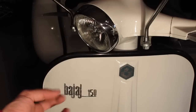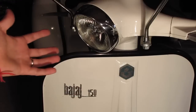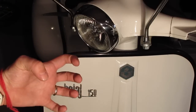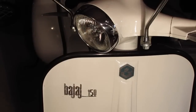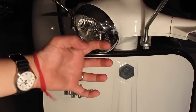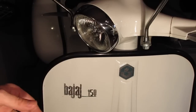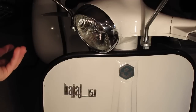Meaning it's just like a speaker membrane, and when it's energized, it buzzes. If it was DC, that membrane would just pop out for positive voltages and suck in for negative voltages, but it doesn't. This thing actually oscillates at the frequency that the AC generator's going for the motor, producing a buzzing sound. I learned the hard way that it was an AC system by putting in a DC